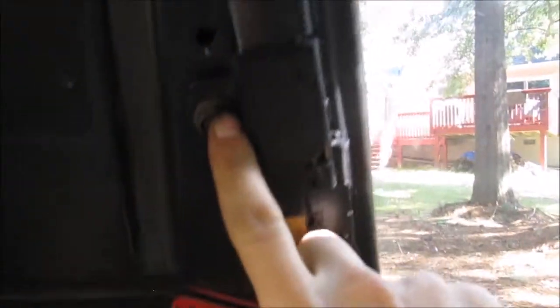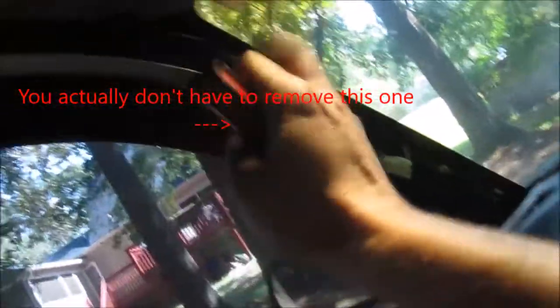That I got this bottom part disconnected, I got another 14 up here, and then I'm gonna take off this. This piece right here is actually where that cover piece snaps into. So you want to keep this piece and then this piece up here. You want to keep these because that's where that plastic trim snaps into. And then you have access to the bolts behind it to take this rail out.